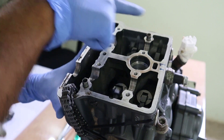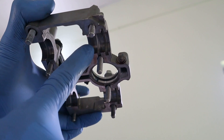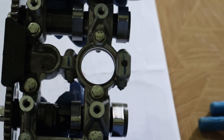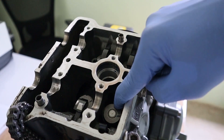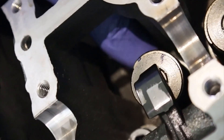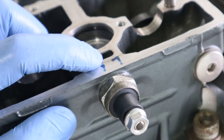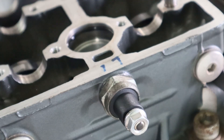Engine oil from this hole enters onto the cylinder head and circulates in these parts, lubricating the camshafts. Four jets of oil are sprayed onto the cam lobes for lubrication. Oil that is sprayed onto the cam lobes then falls onto the rocker arms and then onto the valve springs. Oil then goes back into the crankcase through this hole. From here, the oil passes to the oil pressure sensor to monitor the oil pressure.